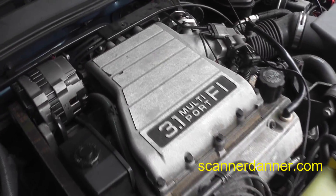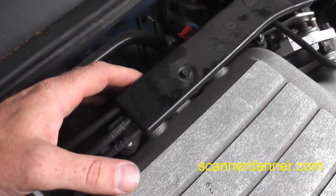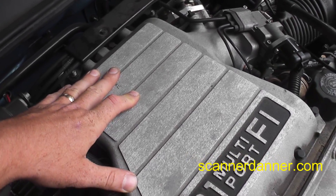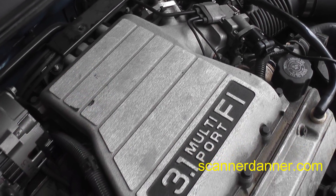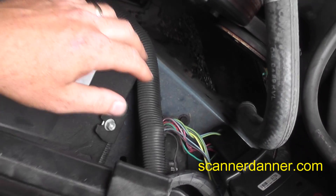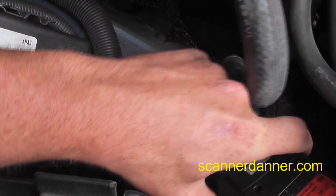On this design, unlike some others where there's a four-pin connector in the back to access the computer-controlled wires for the injectors, this one isn't like that. What you do is take off a plastic cover that sits right here — here's your engine computer — and we can access our injector control wires from here.